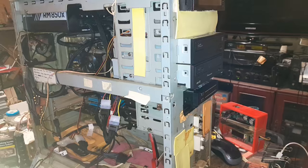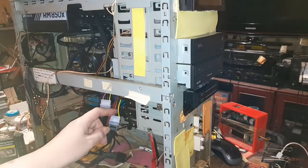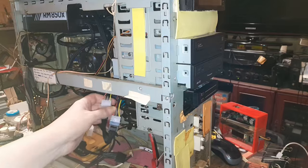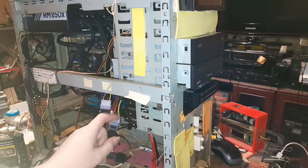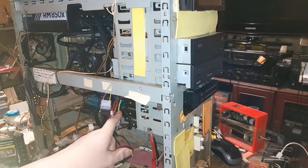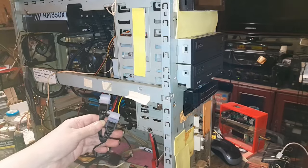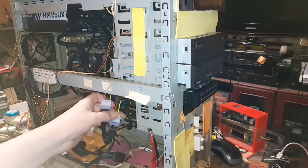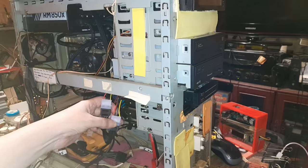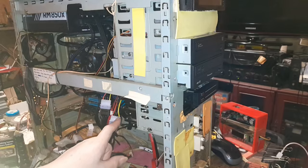You know why I had such a problem getting these plugs to plug in, when they were really tight? The pins on the socket, the leads that came with the adapter module. One of the pins was pushing out the back, and it was bent because the pin was too tight to fit in these. The black ones are the high quality sockets, from Corsair. These white ones are the cheap ones from China. One of the pins on the black earth ground wires was bent because I'd been pushing it in so hard it wouldn't go in, and because the pins aren't centered properly.